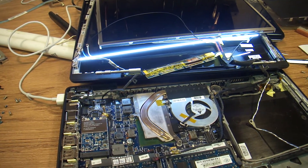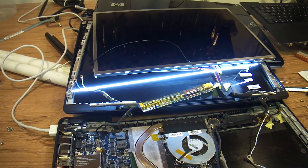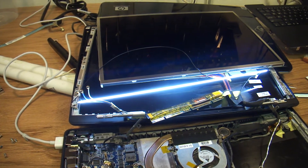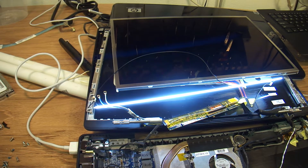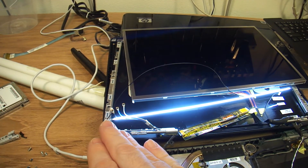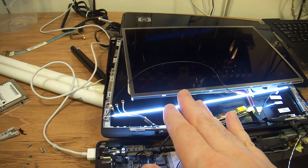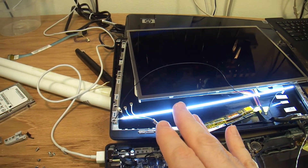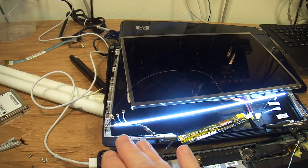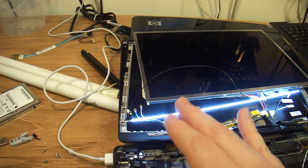This does happen with other computers. So when your backlight kicks in and out, it could be that all it is is a bad connection. Or if your screen is flaky, it could be a bad connection because the light is arcing inside. I've seen the edge of the screen itself melt because it gets so hot, and there is up to 10,000 volts running through this light lamp — so sometimes it could be a fire hazard. When you have an issue with the backlight, it could be a matter of connection between the wire, which is a high voltage wire, and the bulb itself.